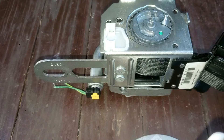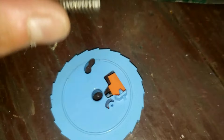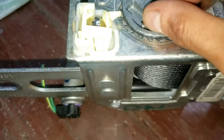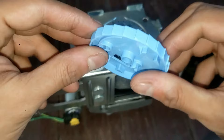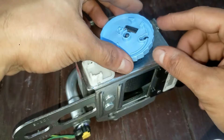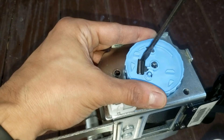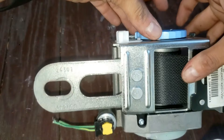Just to give you a good idea: this spring goes here. What's happening inside is the spring sits right on here, and see how it conforms to this screw? When that turns, it goes through here like so. When you put this in like this and put it down, see this hole right here — that will line up with that. See how there's a gap right now? Well, there won't be a gap as you push the spring back. There we go — spring is in, and there's no gap anymore.